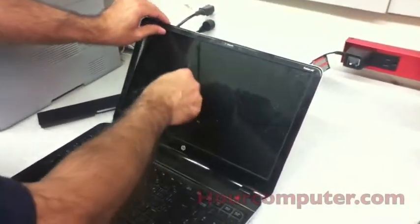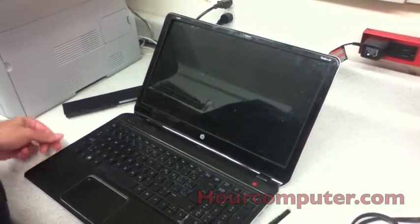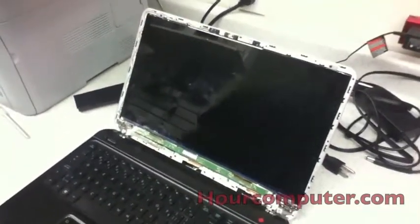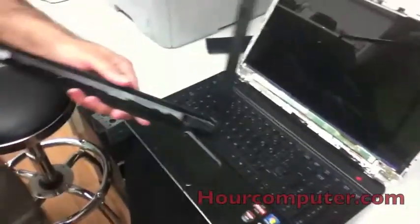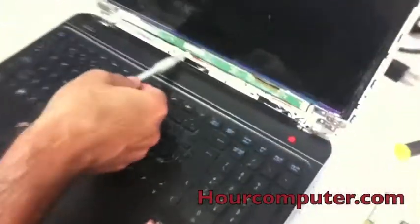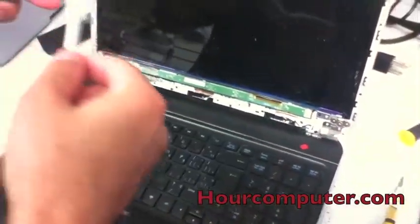You've got to go really nice and slow because there's tape in the back of this and you don't want to break it. So once I'm done taking the cover off, I will show you what to do next. So now we took out the cover. I had to cut this part here — it's part of the shielding for the power inverter. I cut that out, but we don't really care because the new LCD screen that comes already has its own shielding.